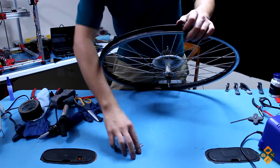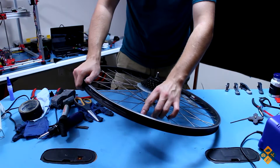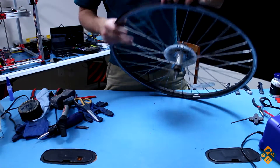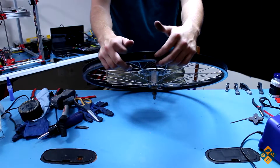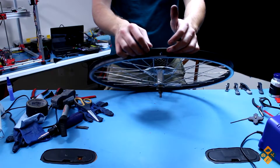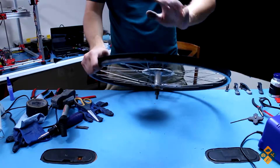I just came upon a problem I kind of thought might happen — this rim tape stuff. See this rubber bit that has these little bumps? They're protecting the tops of these spokes and protecting the actual tube from getting punctured by them. If you're in a pinch and don't have spare rim tape and your old rim tape broke like mine, you can use gaffer's tape — it's a fabric-type tape. It's a little pricey, but it comes in handy for a lot of different jobs because it's soft and really durable. You just want to make sure not to go too thick or you might make the wheel out of balance.